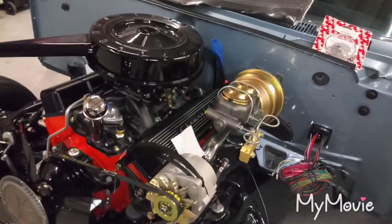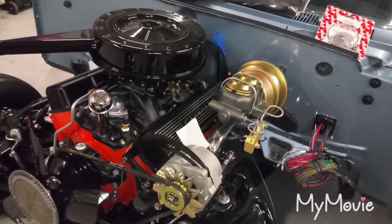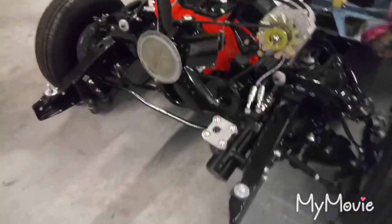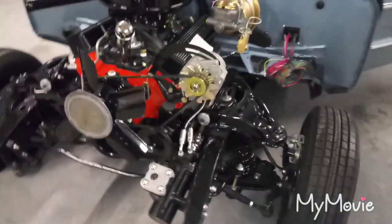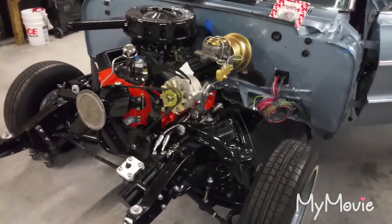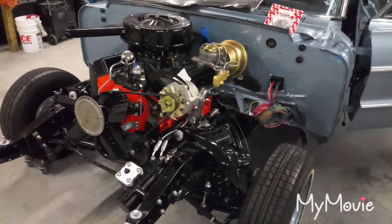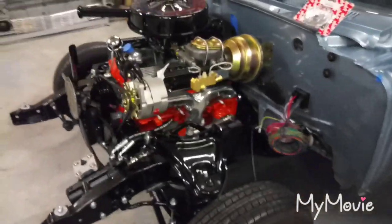I also bolted the torque converter to the flywheel last night. That was a little strange because I had to loosen the bell housing — it seemed like the torque converter was in a bind against the flywheel. I loosened the bell housing and then used a pry bar to move the torque converter to line up with the first hole, then cranked it on the front of the crank with a 5/8 deep socket, turning over the motor to get to the other two bolts, then tightened up the bell housing. So left on the list is the wiper motor and a short list of things I need to buy to start the wiring. It's coming along pretty good — stay tuned, thanks for watching.